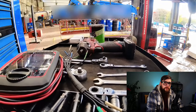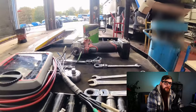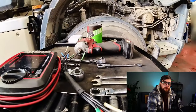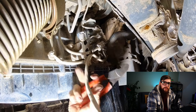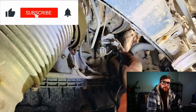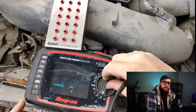So it was time to get more invasive and gather some tools to identify if this was all mechanical or if we had any other electrical issues with it also. First things first, we're going to fit our test leads to the plug for the BPV down by the NOx sensor before CAT ECU. With the wiring disconnected, we can plug in our test lead and use the breakout box to check our powers and grounds, and with the ignition off we can measure the resistance for CAN.